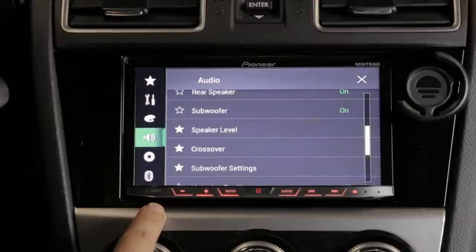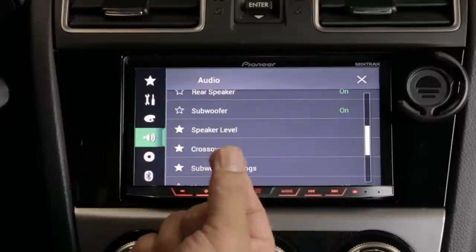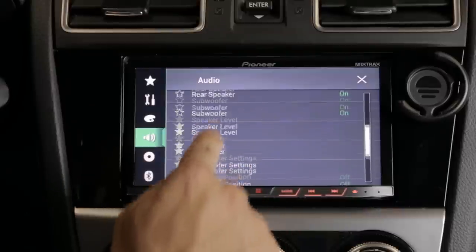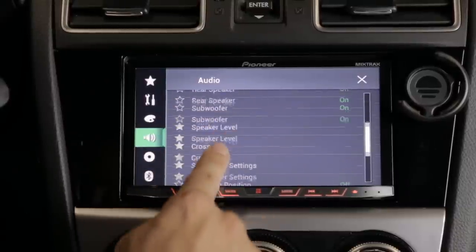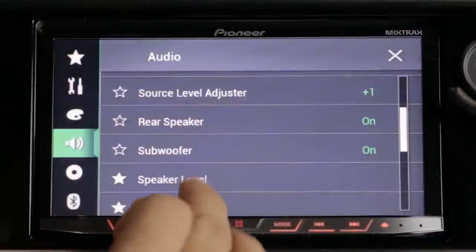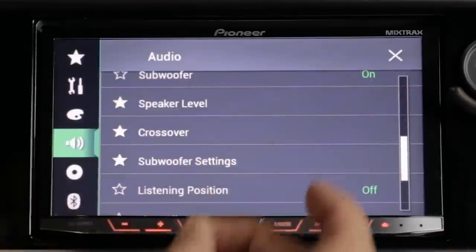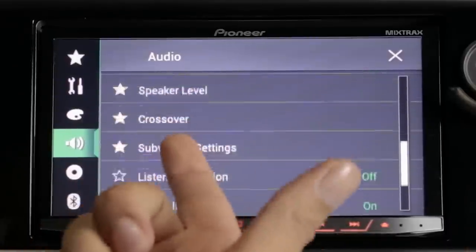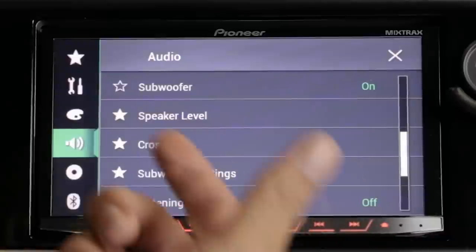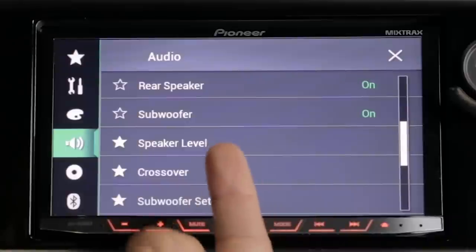You would be surprised to learn that this is actually a resistive screen, not capacitive like most phones. Capacitive screens require you to use your actual skin for them to work. This is resistive, so how hard you push it determines if it works, but it's actually quite sensitive. It even allows you to pinch, which a lot of resistive screens don't do. You can use your nails or anything you want to scroll on it because it works on pressure, not on the capacitive qualities of your fingers.